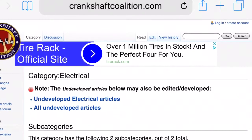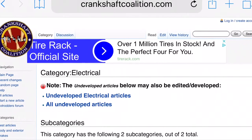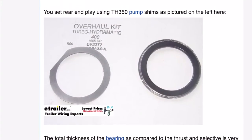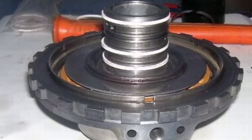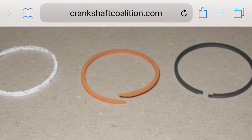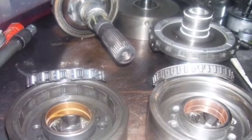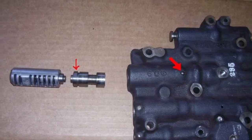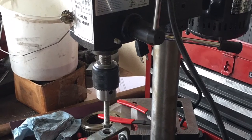Check out this website — it's got the recipe for building a really strong Turbo 400 transmission, including the dual feed for the direct clutches. I apologize for having to end the video this way, but a lot of my footage was corrupt and had a lot of dog barking in the background. If you look on that website, it'll systematically take you through the Jake Shore Turbo 400 build — different modifications and upgrades to make it stronger and handle more horsepower. The only thing I'm not able to upgrade is the reaction carrier that receives a sprag element instead of the roller clutch, because I haven't been able to find one. Thanks for watching.